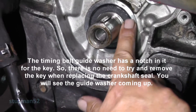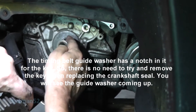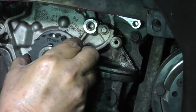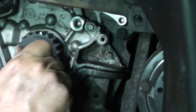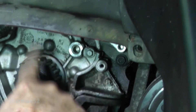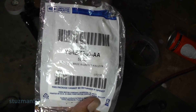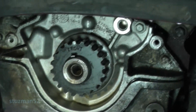Same thing on the other camshaft — I removed that seal and got a new one installed. On the crankshaft snout, I put a very small amount of anti-seize on top of the key and a small amount around the shaft to make it a little bit easier to come off next time. I'm going to get ready now — I'm going to put the timing pin in and get this thing set up to top dead center for the number one piston.